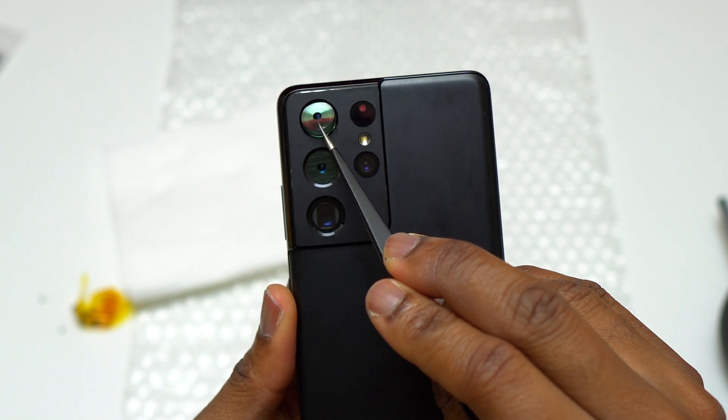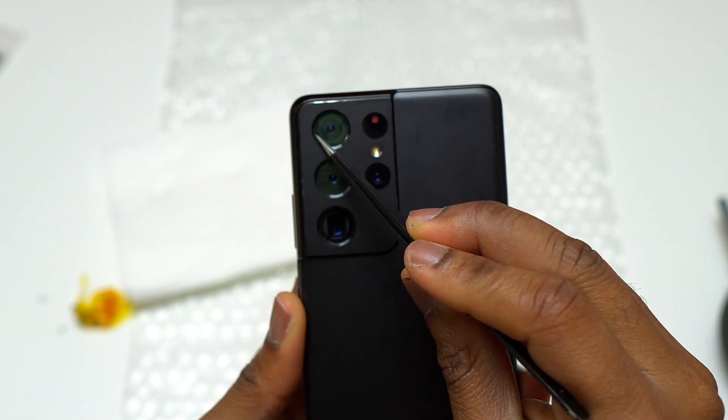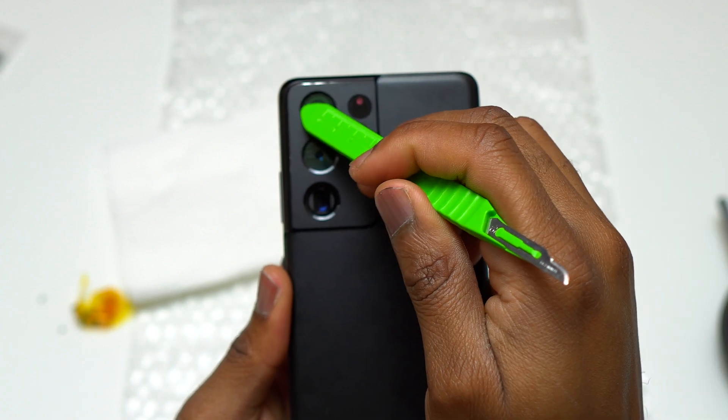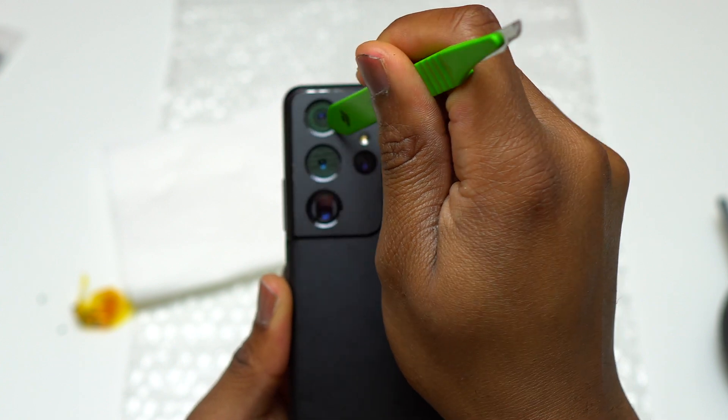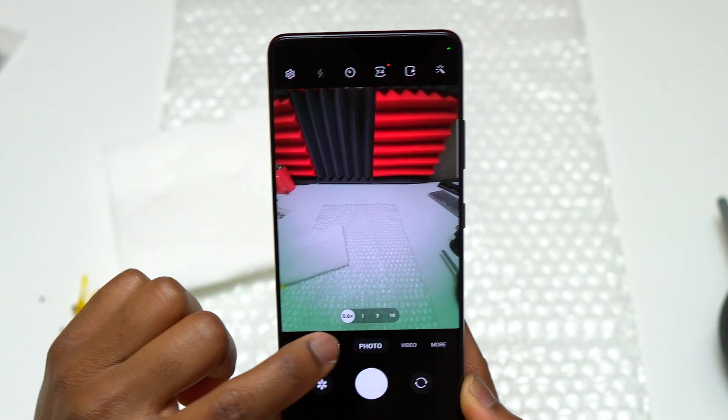You need to do this because if you try to remove the non-sticky side of the double-sided tape after installation, it is going to be wasted. Be careful while applying pressure around the double-sided tape because you risk touching the camera module and damaging it if you use something sharp, or scratching the camera bezel.